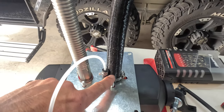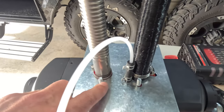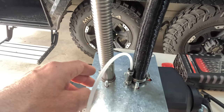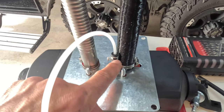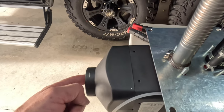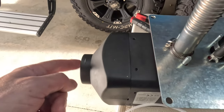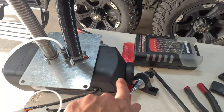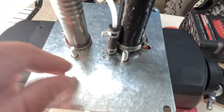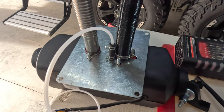The exhaust is furthest away from the fuel line, which is what you want. So the hot side of the heater is the exhaust, and the cold side handles air intake and air outlet — hot and cold, pretty straightforward. Now I'll tighten up all the bolts, put the little nuts on, tighten the clamps, and then it's time to drill the 100mm hole in the caravan floor.